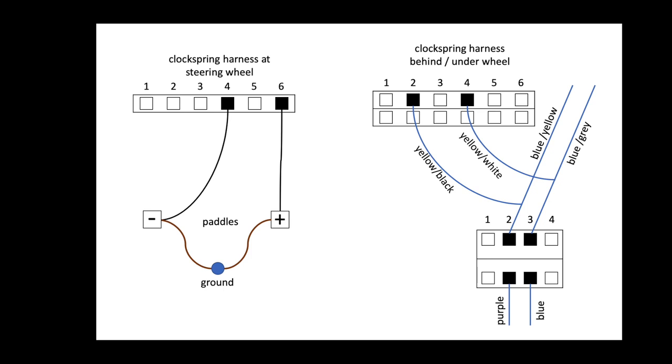Just to give a bit more clarification on how I wired this: I bypassed the multi-function controls because the paddles weren't working correctly when connected through that. So the left paddle — which is your downshift — I wired into pin four, and the right paddle — which is upshift — into pin six on the clock spring connector. You also have to wire the middle wire from each paddle to a grounding point. Moving on to the extension behind the clock spring to the actual shifter: take pin two and pin four and extend them, and those go into pin two and pin three on the transmission harness by the shifter. Here's the diagram — if you have any questions feel free to leave a comment. It can be pretty tricky, so just take your time and double check everything.